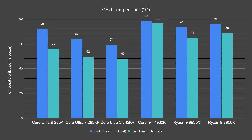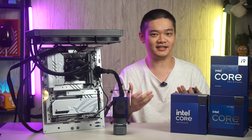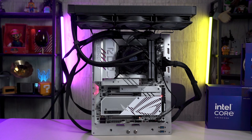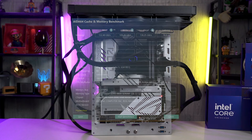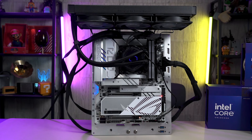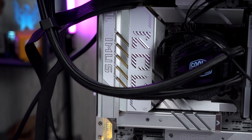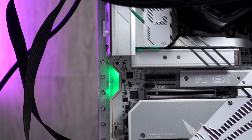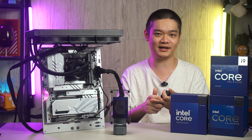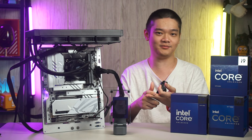This is a huge improvement in terms of efficiency. With a new architecture, a lot of things have changed — so how's the memory overclocking support? For the most part, it has improved. We tested all the new CPUs with our existing and newer DDR5 memory kits, and DDR5 8000+ is easily achievable most of the time. The highest we were able to achieve is DDR5 8600 MT/s using the Core Ultra 9 285K paired with the ROG Maximus Z890 Apex motherboard. Of course, performance can vary depending on the motherboard, CPU, and memory kit you are using. Older kits with lower frequencies might not guarantee DDR5 8000 all the time, but the new CU DIMMs might be an option if you can get your hands on those.